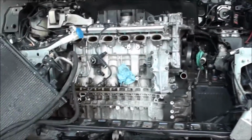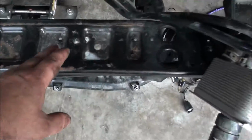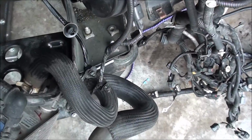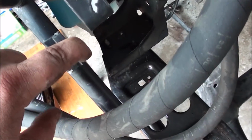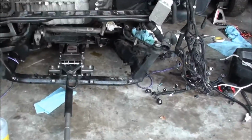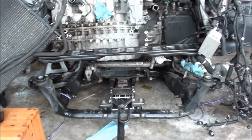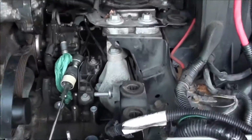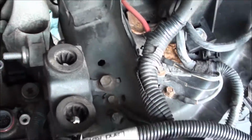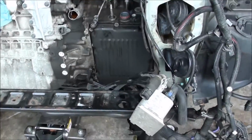I don't know if you could tell on video here, but I am wide open. Once I take off this front rail, which unbolts, like I showed you earlier, right there and over there. My spacing is correct and I'm good at my Tetris. I should be able to lower it, shift it to the right a little bit, because when I undo the motor mount, I'm going to take it off from the engine, clearing pretty much this whole space. So I should be able to lower it, shift it over to the driver's side and roll it straight forward. That should be a done deal.